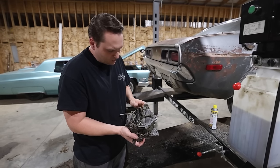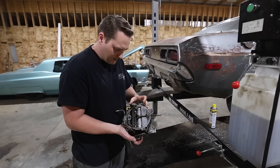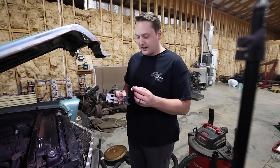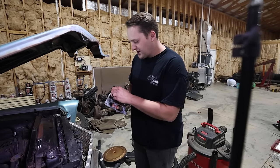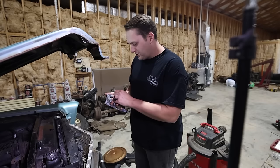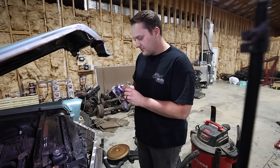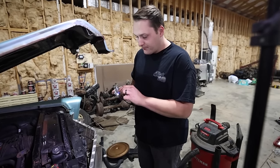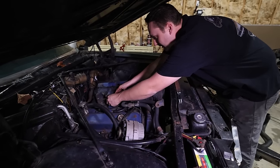I'm gonna need you to just cooperate, please. What in the world is going on with this? Everything's falling apart. We need this to work. Little trick I learned from a Thunderhead 289: you can use some Chapstick or petroleum jelly to keep your gasket from sticking real bad. So I'm gonna use my Chapstick here because I'm gonna assume this carburetor's gonna have to come off. Go with our fancy Cometic gasket right there where it belongs.